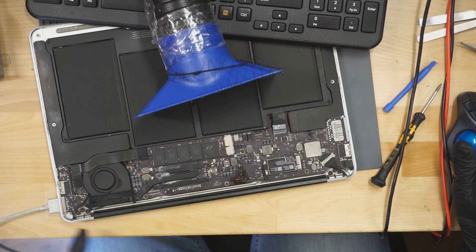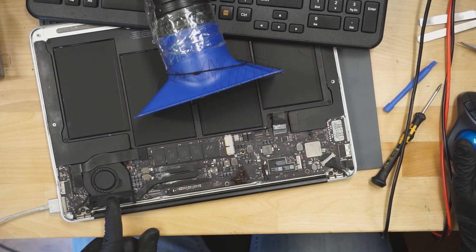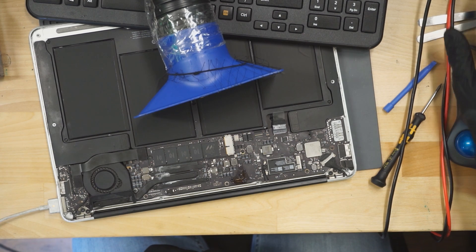Now when we plug it in, we get a green light which turns to an orange light, and a fan spin. Another machine where SMC reset L is being stuck to ground, and all we had to do to fix it was remove a JTAG connector.